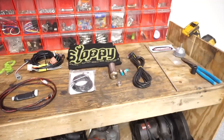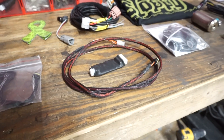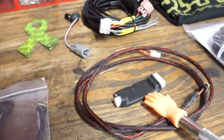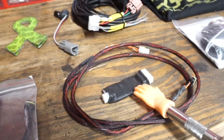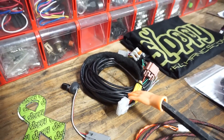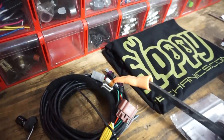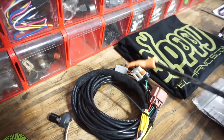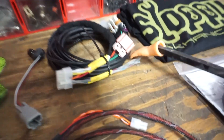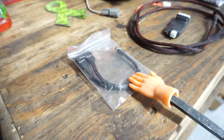Starting to get back to some regular videos. Today I'm going to be working on the truck a little bit, adding a few sensors and hooking it up through this CAN bus I/O module. Matt Happel sent me a hand with this — it's the Boost Smart I/O module. This goes to the Holley Terminator and adds extra inputs and outputs. The pre-wired harness goes to the CAN bus module and has flex, alternator, dial boost input, two sensor inputs, and four different outputs.